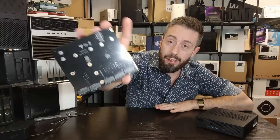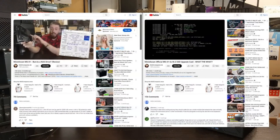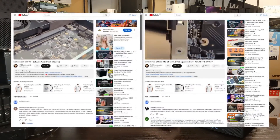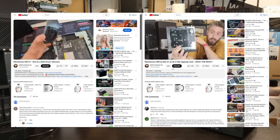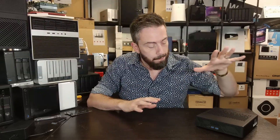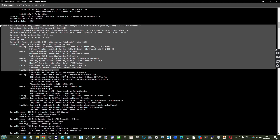Bringing things back to network attached storage, let's talk about that storage. A note to some in the comments: the prototype expansion board sent by Minisforum a month or two ago does not fit inside this device. This only supports what's built in. The MS01 — which we've reviewed before as a NAS — is still the better NAS option between the two. Inside, the four M.2 NVMe slots break down as: one 4x4 speed slot, one 4x2 slot, one 4x1 slot, and one 3x4 slot. As a NAS, that lane distribution is a real concern — if you RAID across all drives, you'll be throttled by the slowest.